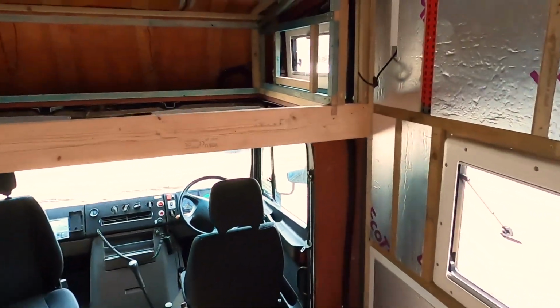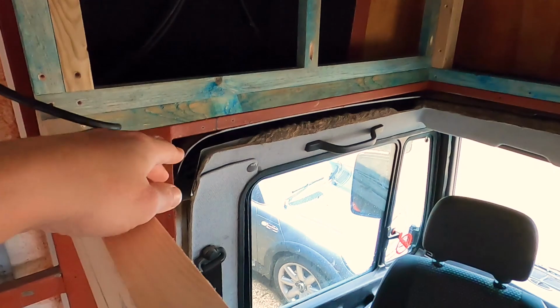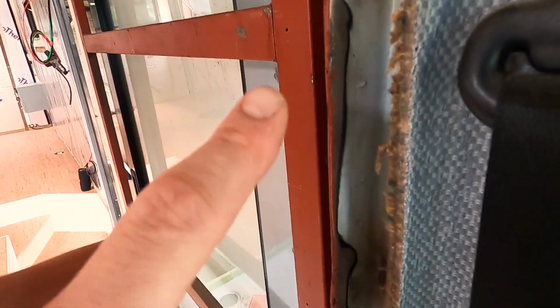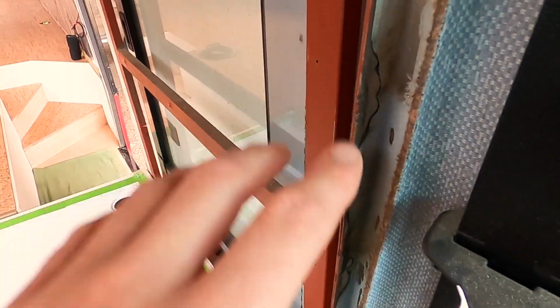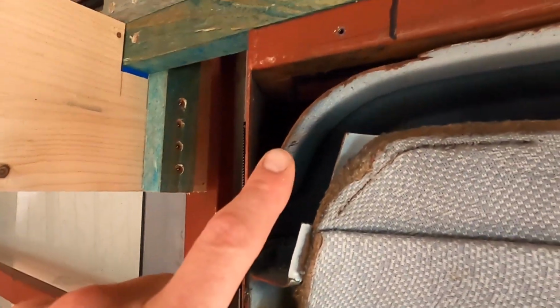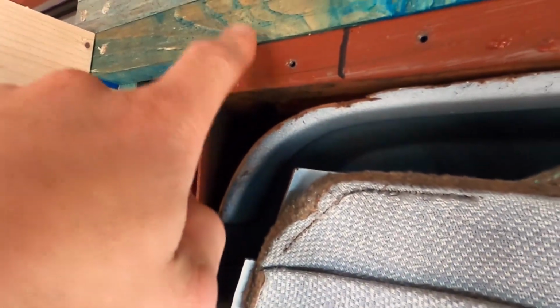Up the front here, the reason we haven't put any insulation up here yet is we've still got to finish off, first of all, priming all the edges where they never put any paint protection on them. As you can probably see here, this is where they've welded, and literally there's nothing on it. So that's bare metal, which has been there since 2007. I mean, amazingly, there is no rust on it really, probably because it was never touched after it was cleaned off. So there wasn't any moisture there to allow the rust process to start. But you can see up here, this has started to rust very lightly on the edges. So what I'd like to do is clean all that off, get some red oxide primer on it, like they bothered to do on some of it, but not on other places.